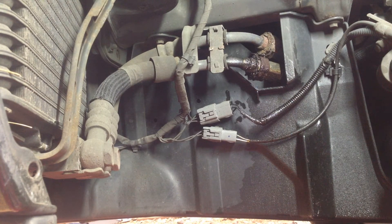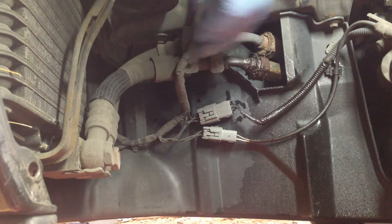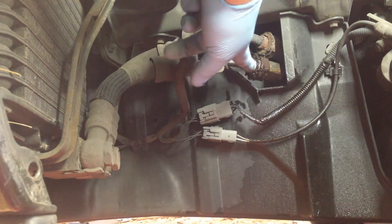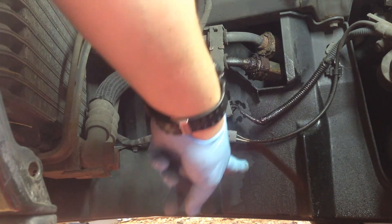With the arch liner off, you can see this is the cause of the oil — this lower connector here. This is normally the one that goes to the front of the engine block. You can see where it's quite badly corroded and it's actually been spewing oil over time down the under tray side support, connectors, and wiring.